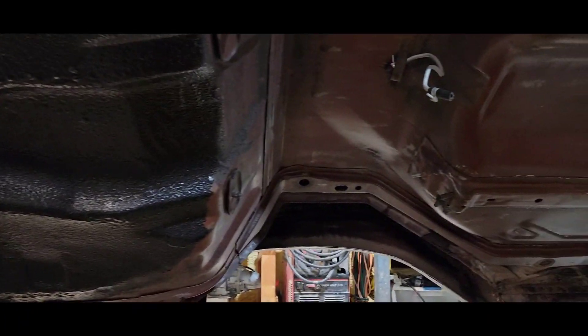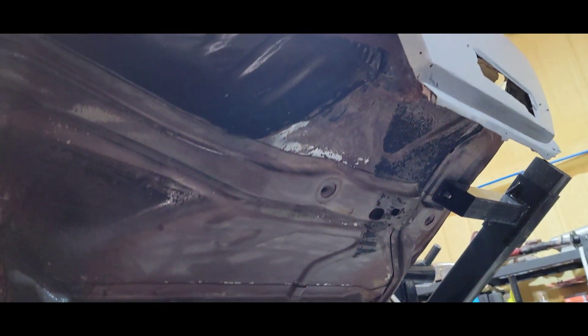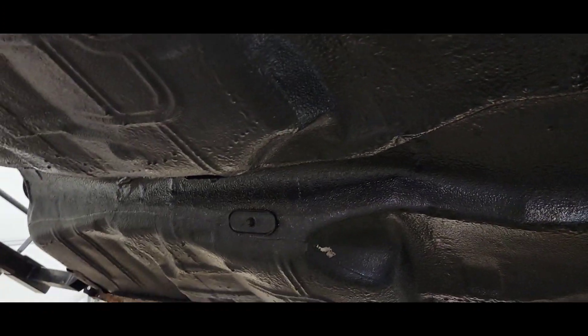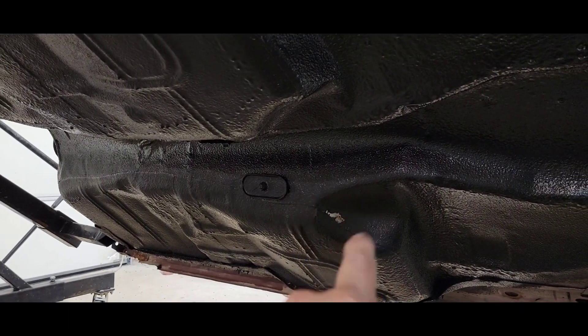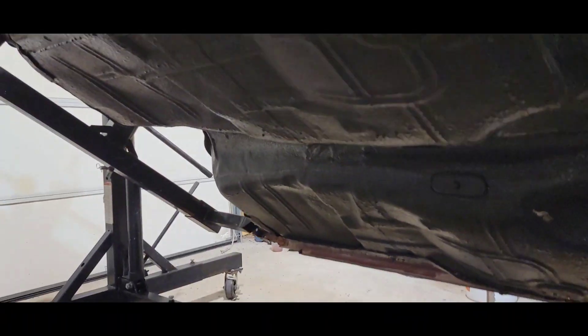All the way around, clean up the edges where the bed liner didn't stick. I got to fix these holes that I had to drill in my pans when I had water that sat in the car for a while when it was sitting outside the shop. Everything is power washed and cleaned under here. I got the power washer out and was able to get a lot of the original undercoating off. There's still specks here and there that I got to hit, but I'll do that with the wire wheel and the DA. A little bit of it flaked off right here, so I'm going to clean that edge up, spot spray it, and then the floors will be done.